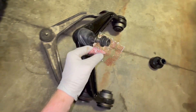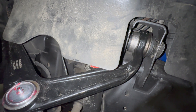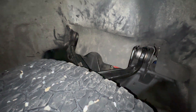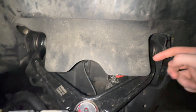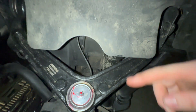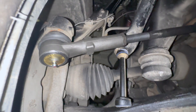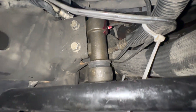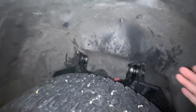On the driver's side, I just finished installing the upper control arms without removing the inner fender well. I installed the tire back onto the truck so it's sitting under its own weight, which allows me to torque down the bolts — 140 foot-pounds for the bolts up top and 37 foot-pounds for the ball joint. I went ahead and greased it. Once I finish torquing this side, I'll go around and grease everything: tie rod ends on both sides, upper control arms, the idler arm bracket housing and ball joint, and lastly the pitman arm.